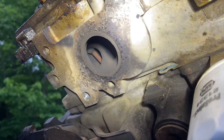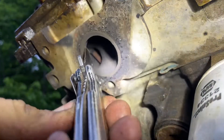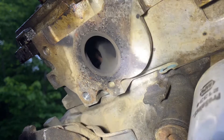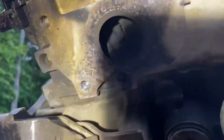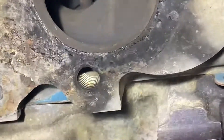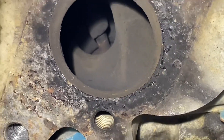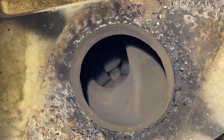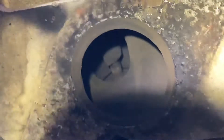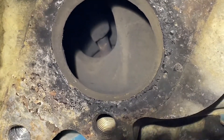See that valve guide right there? That valve guide's okay — that's one of the exhaust valves on this cylinder and it's fine, just sticking out a little bit, which is normal. Now look at this other valve guide. That valve guide is nowhere near like that other one — it's sticking way out. You can see that exhaust valve is open up in there. See that gap where the exhaust valve's open? That valve guide has come down out of the head. It got hot, stuck on the valve, and the valve pulled it down out of the head when it was hot. Too hot. So I've got to replace that valve guide — I've got to get the head off to do it.